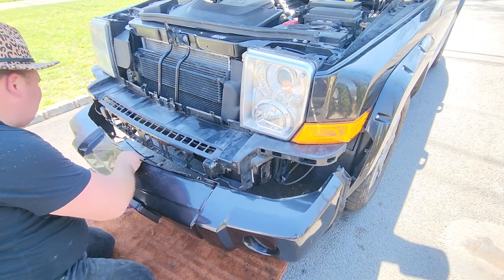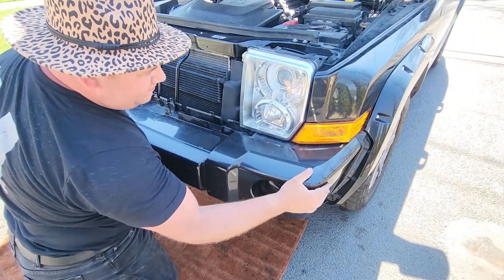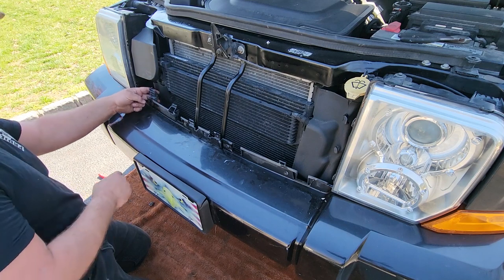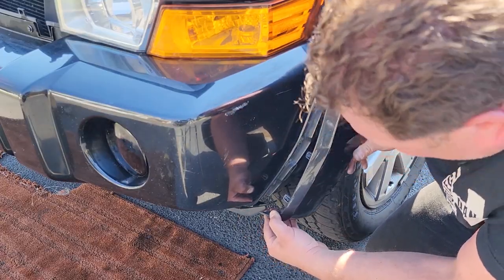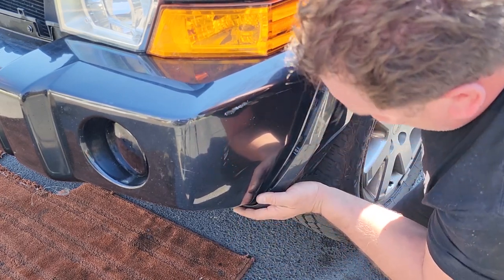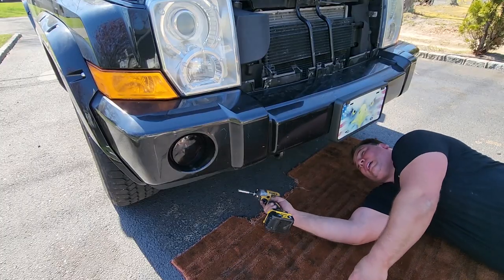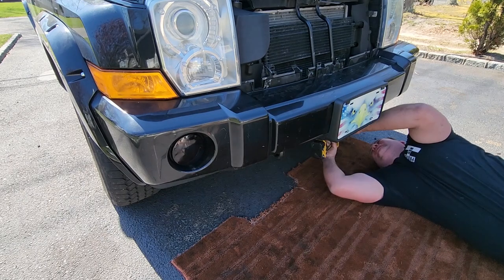This bumper is going to slide on nice and neat right over the header panel. It's kind of floppy so I've got to do one side at a time. The rest of the bumper is really easy — just slide in these little pushpins again. Right here is a place to mount your ambient air temperature sensor. For some reason these never clip in right so I just wrapped a zip tie on it — no biggie. On the sides we're just going to fold in this little piece of the fender flare until it clips on the bumper, and clip in all the little fasteners that connect the flare to the bumper. Last but not least, the two 10mm fine thread fasteners.